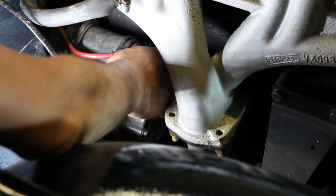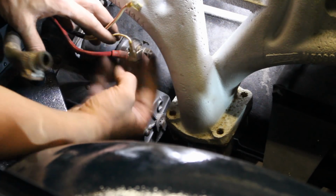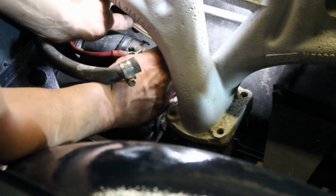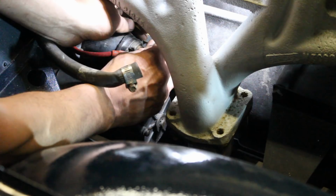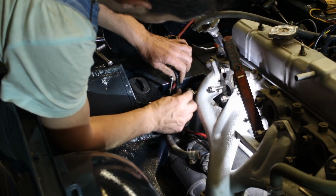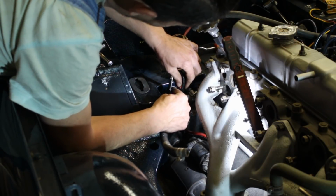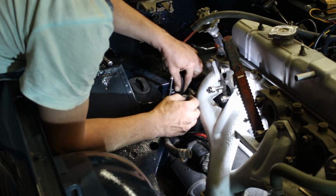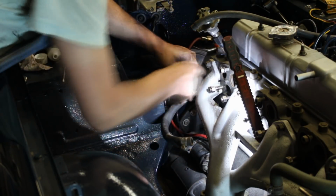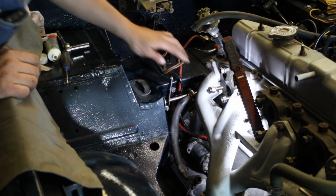And the two little terminals are at the back. One on top of the other, so the white and yellow goes on the bottom, and of course the one on the top takes the white and red. And now we can put a clip here to hold the two wires and keep them away from other things that are here, for example the gas pedal shaft. Okay, so that should keep them away from everything else.